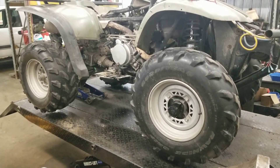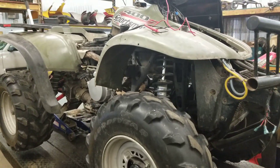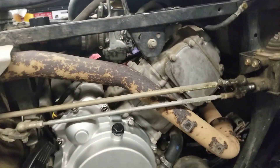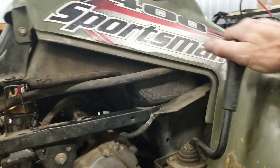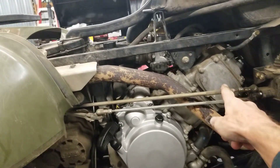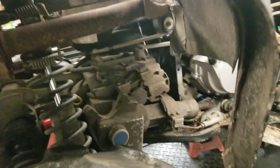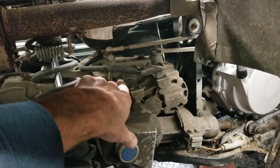This was an electronic issue, and I wanted to point this out too — I've had this issue in the past. There are also transmission shift switches down here, and if your shifter is not lined up right, if it's shifting hard into gear — like this one isn't perfect, it's a little stiff. Some of them are so worn out that it just has to be that way. There is a way to bypass these.